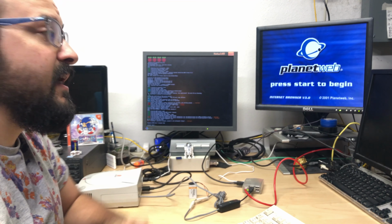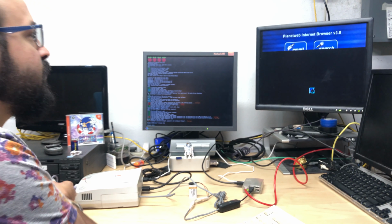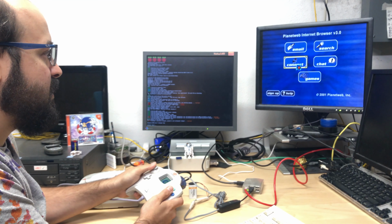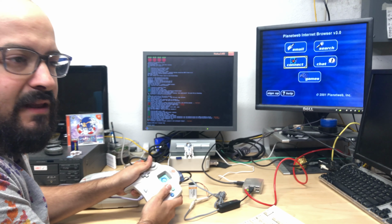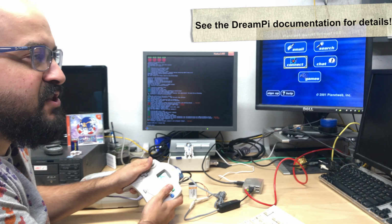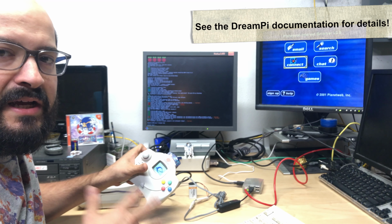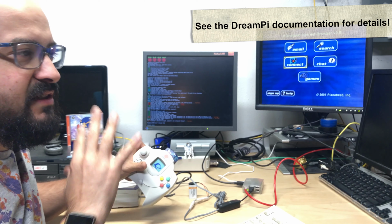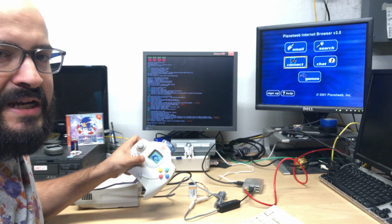Alright, so we're ready to connect to the internet. I'm going to press start on the controller, and we're going to have a few options here. So I'm going to use this since I don't have a mouse, and I'm just going to hit the connect button here. I already configured my dial-up settings, essentially just use the defaults, at least in my case, but follow the DreamPi instructions. I'll put a link in the description if you're going to do this, but you just want to make sure that you're using default stuff, simple phone number, simple password.